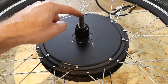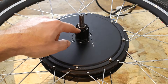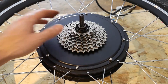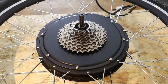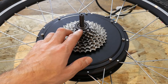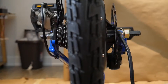I'm back after successfully drilling out the center of the spacer — you can see it now fits over the 12mm shaft. On the inside I was also successful in prying out the dust cover from the original wheel, and it fits inside this hub since they should be roughly the same dimension given the cassette fits over top. We're at the point now where we can slide the cassette over top, along with the remaining sprockets, and then fit the lock ring. You can see it spins around and does not contact that center spacer at all, and it still passes through the lock ring since we didn't modify the outer diameter of the spacer.